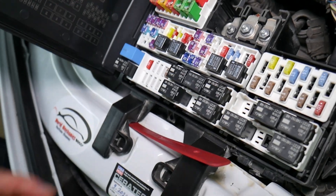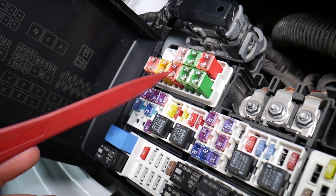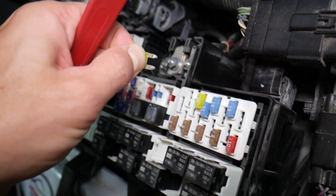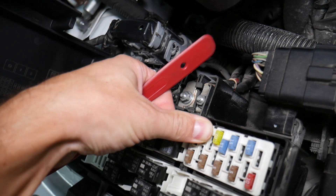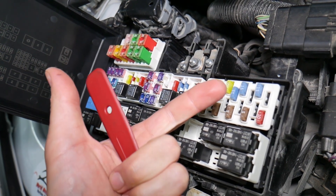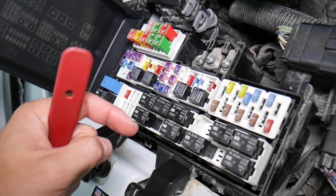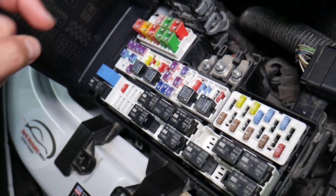It is very important to test fuses and relays. On those fuses, you cannot clearly see if they're burnt or not — especially you can see that in ATC fuses as well. If you remove a fuse, look at it, and assume that it's a good fuse, but it's actually a bad fuse — sometimes you cannot clearly see that. What can easily happen is you put the bad fuse back in and start replacing parts and tools that you don't need to. So you lose your time and money fixing a problem that doesn't exist, when all you have to do is test the fuse and replace it. We'll put a link to a special video that will teach you how to test fuses and how to check relays very easily — check it out, it will be in the description of the video below.